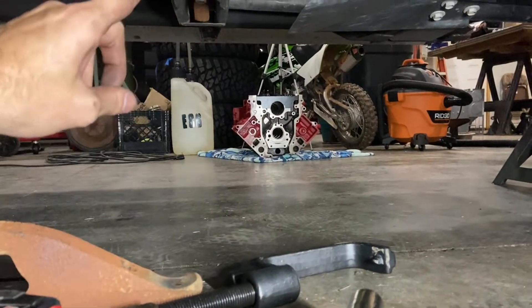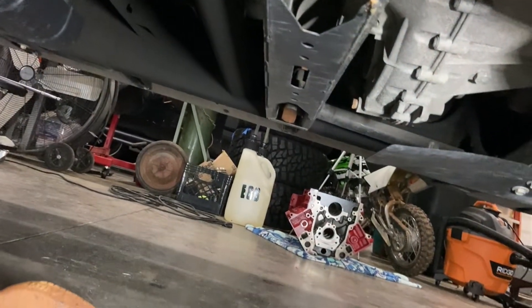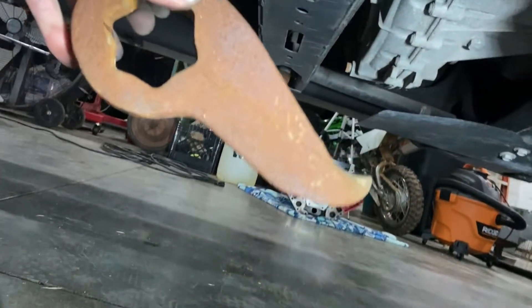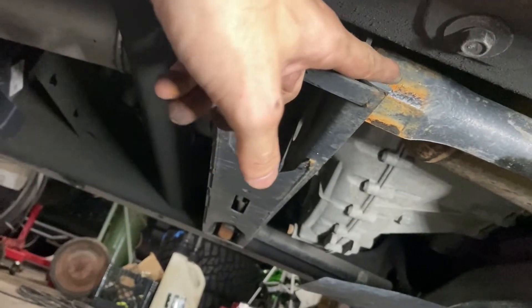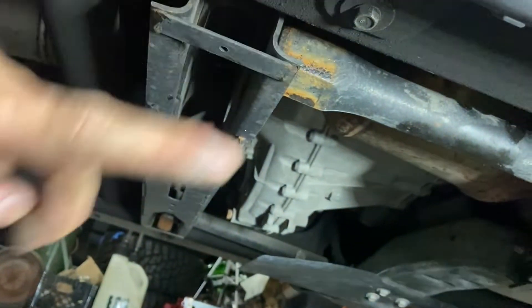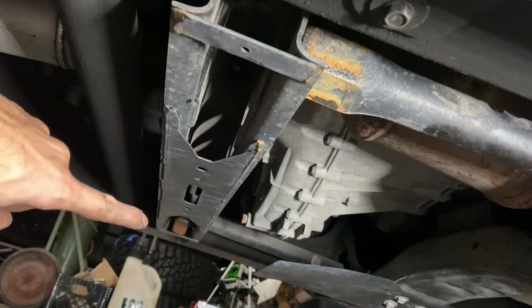All right, so we used the tool — once we pulled the lock out, cranked it up, loosened it all the way down, and then dropped the old key out. Don't need that. We'll grab our new key, fit it up onto the torsion bar. I don't think we install the bolts just yet, but we'll get it set up there and then move to the other side, do that one, and then we'll start up in the front.